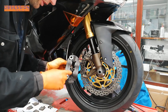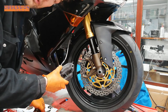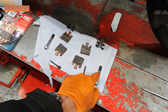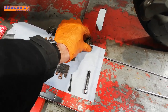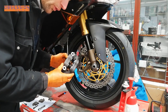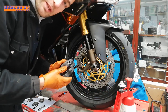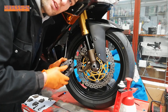There we have the caliper stripped, and you can see this one's pretty clean — not bad at all. I think these have been quite well looked after, especially given we have nice stainless bolts and bits. I'm still going to give them another clean and then put new pads in. This is how I arrange things when stripping a caliper: top bolt, top set of pads inside and outside, bottom set inside and outside, spring plates in the correct orientation pointing up — that way when you come to put it back together it's just easier. To clean the calipers it's fairly straightforward: I have a toothbrush and some brake cleaner, and to push the pistons back in afterwards with a little bit of lube against the dust seals I use a squirt of GT85. Some people like to clean calipers with soapy water — it probably works perfectly well — but I've never been a fan of adding moisture into the system. No real need to; I find brake cleaner seems to work okay.